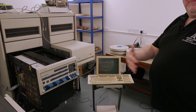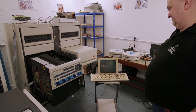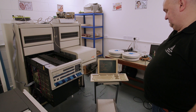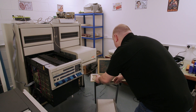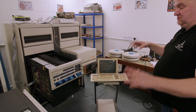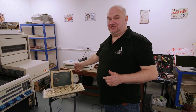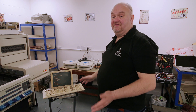We can hear the disk heads seeking within the disk pack to read data to start the computer. Now the next thing is to change the date — obviously we had the incorrect date before — so I'm changing it to 06-FEB-22 and leaving the time as it is. Now I'm going to start the computer. When it boots off the disk it's in single-user mode, but the PDP is able to support many simultaneous sessions on terminals. This is now starting the computer into what's called time-sharing, which allows it to run multiple jobs — tests or business applications.